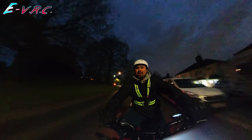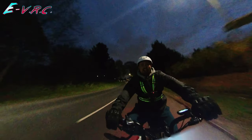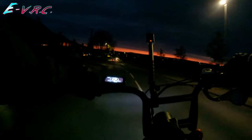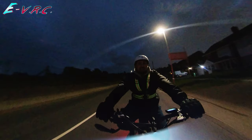I'd actually already done the hill climb test as well. I wouldn't really have expected a higher top speed since the two 48 volt batteries are wired in parallel. This means it doesn't create a 96 volt battery — instead it acts like a 48 volt battery with double the capacity: 26 amp hours instead of 13. But electric motors do work best with full batteries, so maybe with the two battery configuration it's as if it has a full battery for longer.